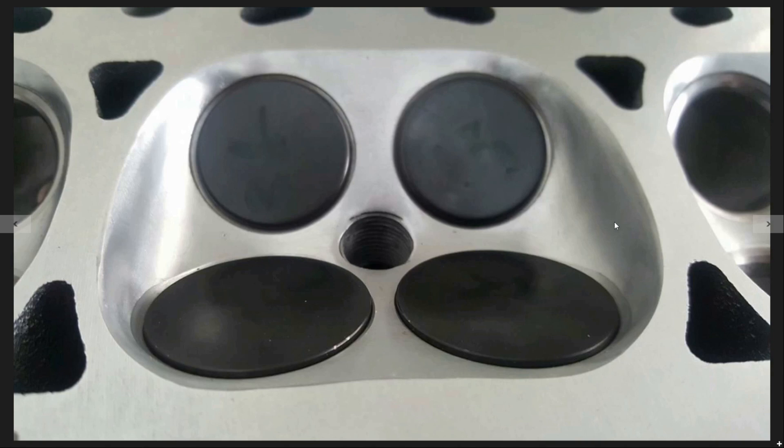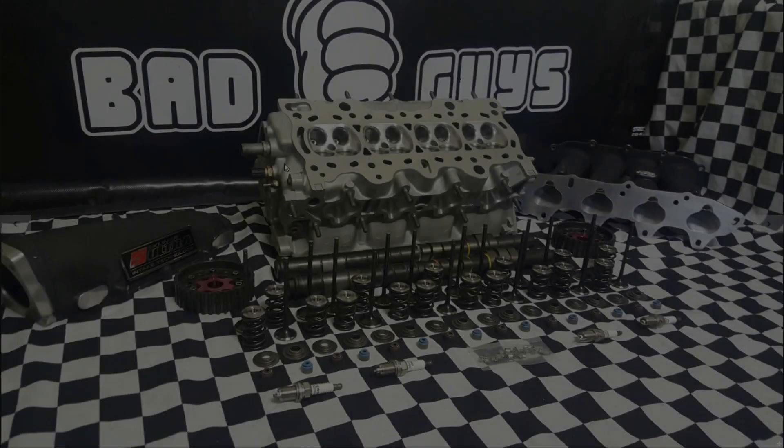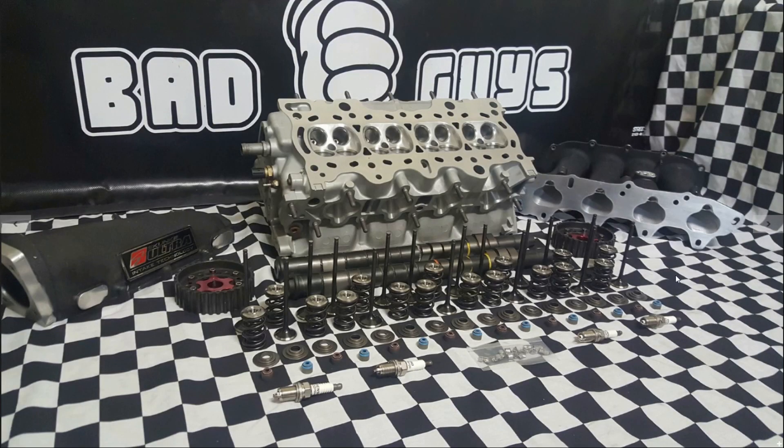All of this has been smoothed out — all the casting imperfections and rough edges that are there from the factory are gone. This is going to give us a wider tuning window and make it more knock and detonation resistant, especially running a lot of boost. Every degree of timing you can add gives a tremendous amount of horsepower gains, so the more timing you can put to it the better. The same applies to nitrous, which is the most timing-critical of all.